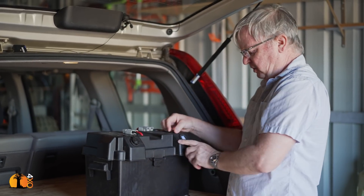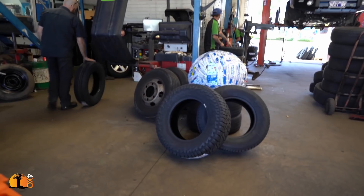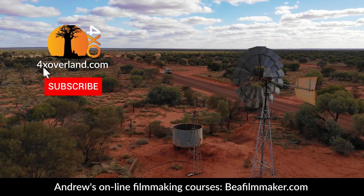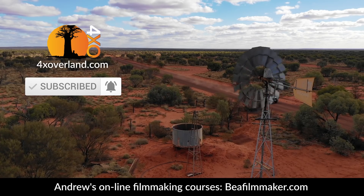Here's a tip to increase the life of an AGM battery in this kind of environment where it's connected directly to the vehicle: it will never get a 100% charge because of the voltage drop. So every month or so, run an AC charger onto the battery and give it a full charge. Do that once a month and this battery is going to last three or four years of quite hard use — that's the difference it makes. If you never charge it to 100%, by two years the battery will be very tired and almost time to replace. Thank you for watching — if you haven't already, subscribe and click the notifications bell so you don't miss our weekly videos.